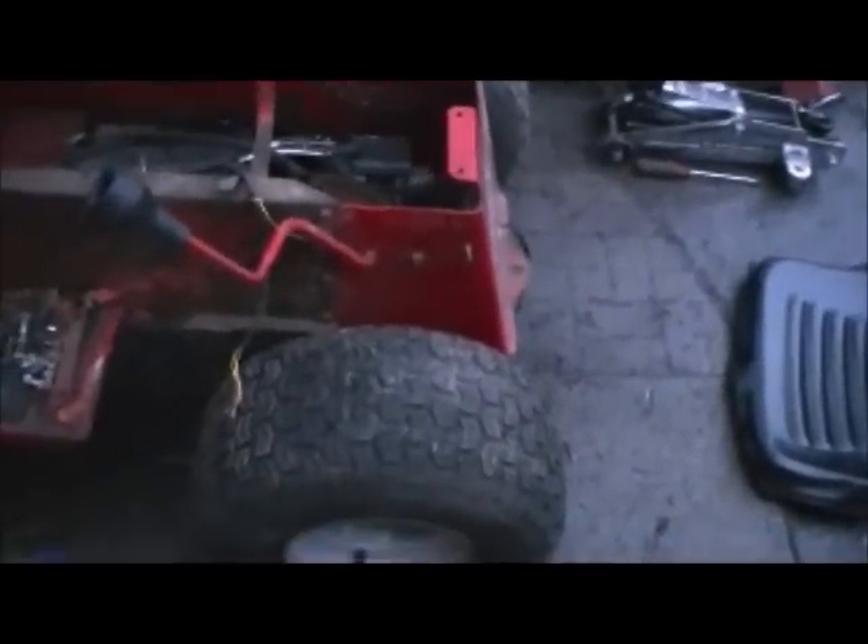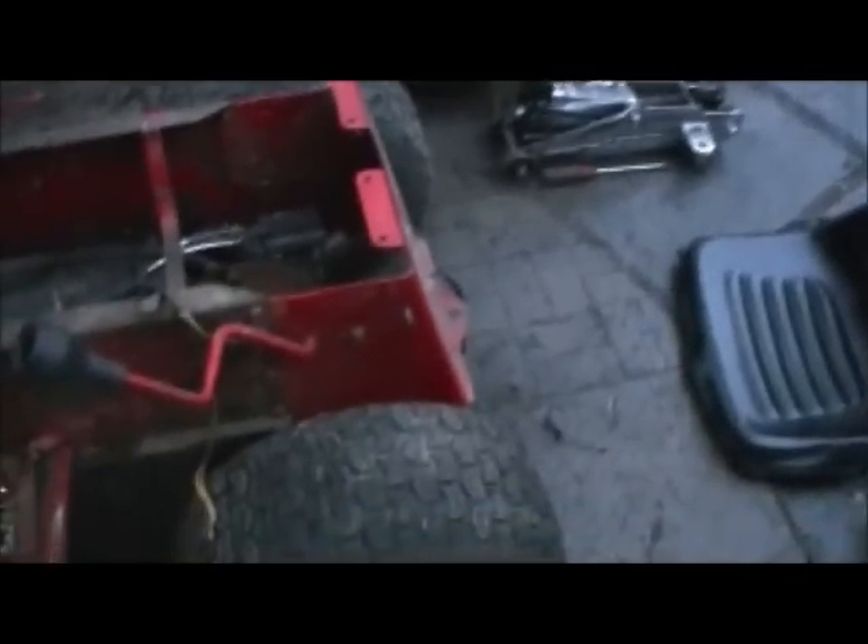This is probably going to be the last update for tonight. I know I didn't really show much — it's just a lot of measuring right now and trying to figure out where everything's going. I got the rear end in place, got everything lined up. It is square with the tractor. I ended up using those brackets on each side — those are the ones I'm going to end up using. I was just looking at the Murray a few minutes ago and it actually has a couple brackets that will work for something in the future. I'm going to take about an inch and a half to two inches out of the frame. I measured it down and it's about an inch and a half, so anywhere from an inch and a half to two inches out should be perfect.